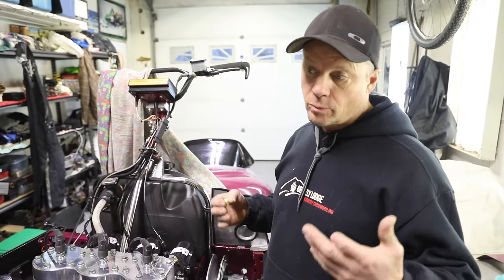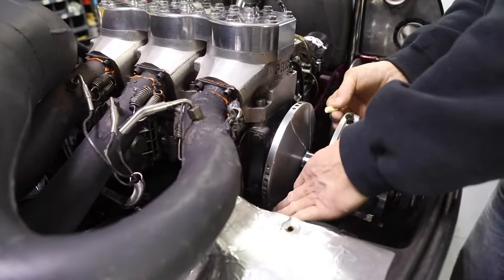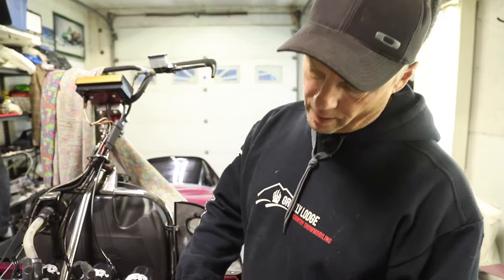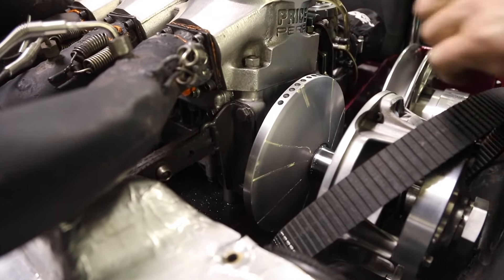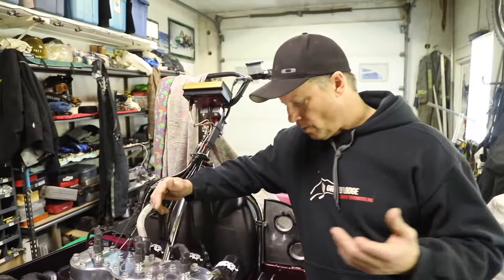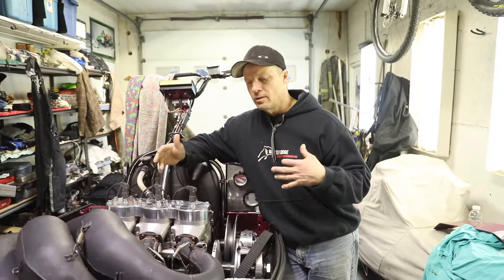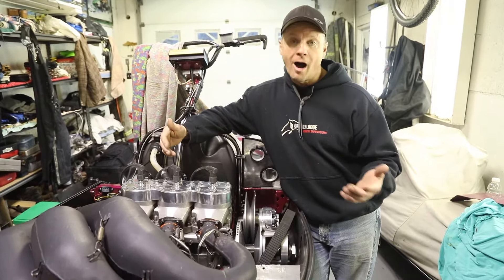As a tuner, most tuners will say: if you want to see how your clutches are performing, we chalk the clutch. You'll be able to tell how high your belt is running in your primary. If you've got that much chalk left, you're not using all your clutch. That means either your weights are too light, you're over-revving, your helix is too steep, or you're geared way too tall and just can't get it going. That tells me my clutch is not working right, so you're probably going to end up with some hot clutches. You've got to check your clutches all the time, see if they're hot.